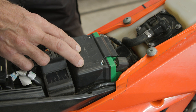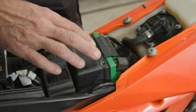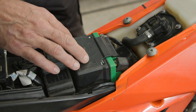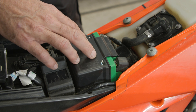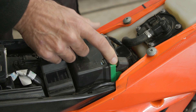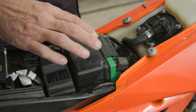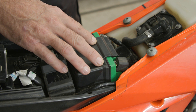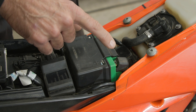However, if you're finding that the battery does go flat after a couple of weeks, one week, or shorter, you certainly want to look into that and find the cause. One common issue can be that if you've connected aftermarket accessories across the battery directly, it might be drawing a high parasitic current causing the battery to go flat. A good way to debug that is to measure the parasitic draw on the battery during storage.